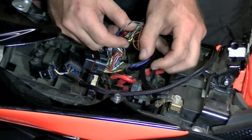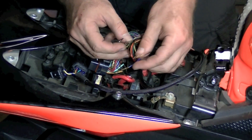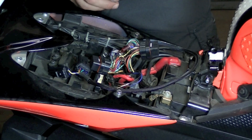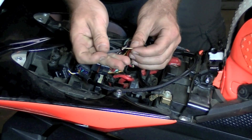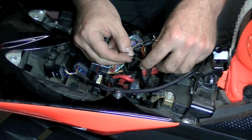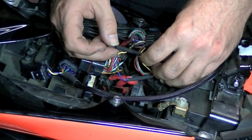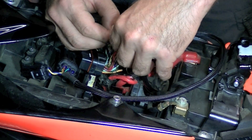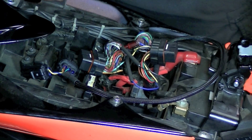You're going to see that you've got a couple of exposed wires. It's very important that you look at your installation guide to know exactly which wires connect to which. As you can see, one's got a male and one has a female side and they just connect like so. We also provide you with some heat shrink tubing — go ahead and slide that right on over. Then go ahead and connect the two wires or pins, slide the heat shrink tubing over them, and then get your heat gun. At that point, you're done with the installation.